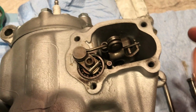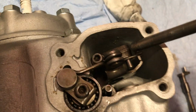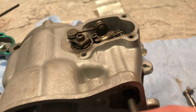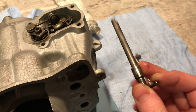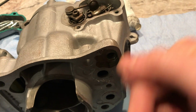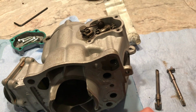So there's no airtight seal between the actual power valve gates and in here, and whatever is in your cylinder is going to try and bleed through down the hole that this rod fits into, like this. Besides the rod itself and this bushing, as you can see, they're not exactly airtight, so this all needs to be lubed up to prevent pressure bleeding down through here and into your right-hand crankcase half and out either your crankcase vent tube or your oil cap if you had that removed.